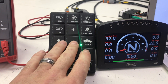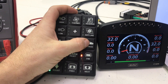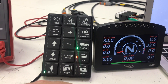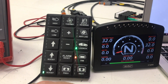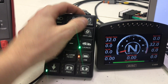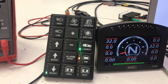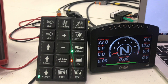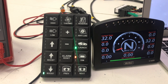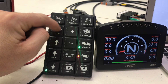The minus and plus are just kind of placeholders. The launch button is to turn up three different levels of launch control, which becomes a driver switch in the M1. We send that data over the CAN bus from the C125 to the M1. We also have a rolling anti-lag, so we can push that to activate it. Some of this we'll take advantage of, and some of it we really won't use on this particular car. But what I want to stay focused on today are these four buttons here.